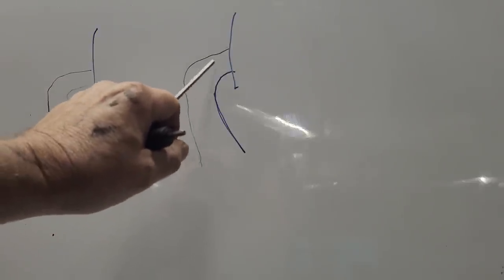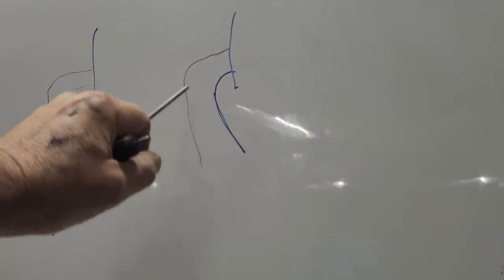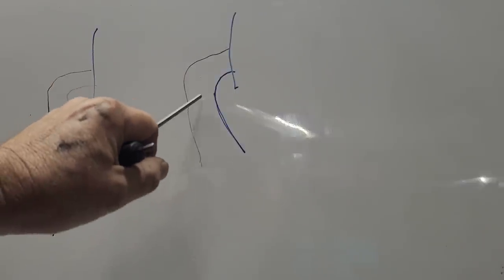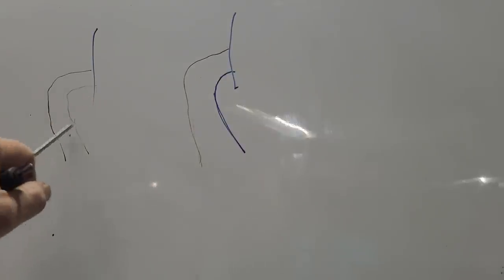By creating this pinch point instead of having this entire section as a pinch point, I've accelerated my air — that's a tunnel ram effect. I've let it come through, accelerated it right here, then given it a larger area to turn. This does not create as much pressure here as having the whole section choked, which creates a lot of pressure before that piston clears. This is your long-side radius and short-side radius — that's going to become important. Air doesn't like to bend; it wants to go straight, and it's coming in very fast.